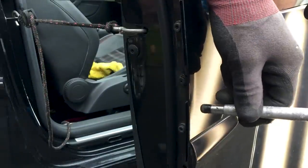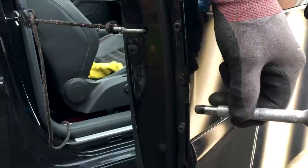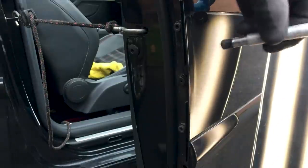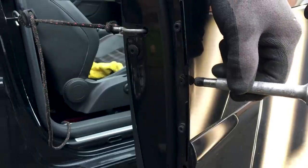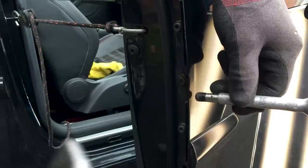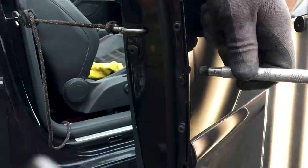Once this is achieved, the next thing to do is to correct the hard line that's been created here just in from the edge. This is the pivot point of where the metal has bent around — it's actually the frame pushing through into the outer skin, as I demonstrated earlier on my mock-up model. This is quite common when a metal edge bends around, and also when you bend it back the other way you're always going to get a hard line or fold line. To remove this I'm using one of my nylon tap downs. Depending on how bad the line is, I always make a choice of how sharp the tap down needs to be. In this case the crease line wasn't very sharp, so I started with a more rounded nylon tap down tip to gently knock this ridge back down.